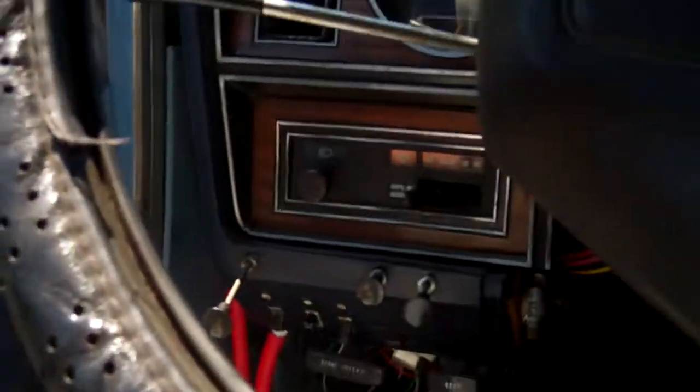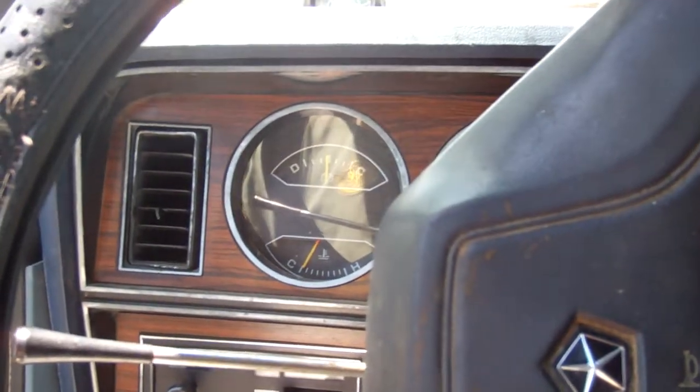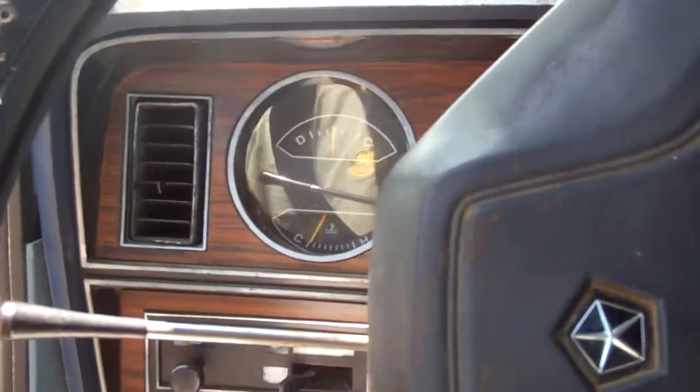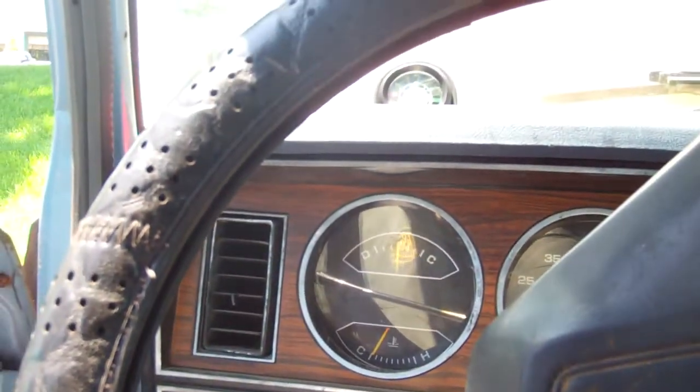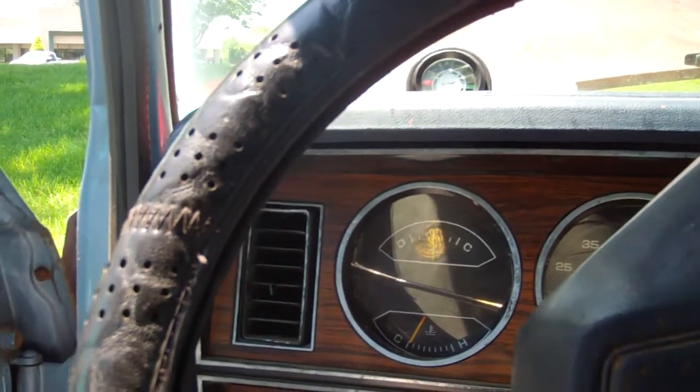Oh, of course, I'm forgetting the first thing you'll probably forget too, which is we've left the blowers open. You've got to shut the blowers. If you don't shut those, it'll just keep sucking air right through it. So once you get it going, turn the blowers off and shut that thing. Now we should be able to pull more. Yeah, now we're able to pull a lot more vacuum through it.